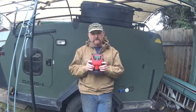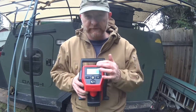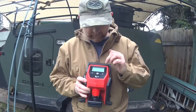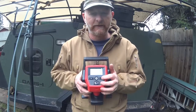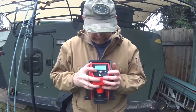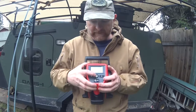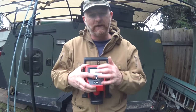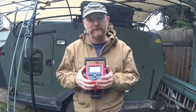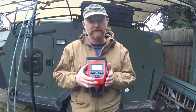Pressing it on — from there we have a display. There are overheat scenarios and battery life indicators. The battery is low; we have used it already. I can inflate by pressing plus and minus to set what I want. If the display doesn't seem right when I plug this in, I can press the power button and the plus button three times to auto-calibrate. I did this today because on the truck it said 36 PSI but this said 33.5. Now it is perfect.